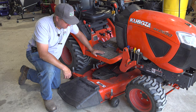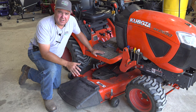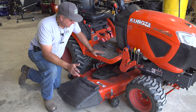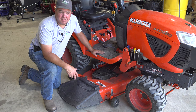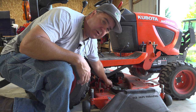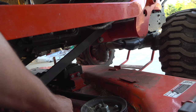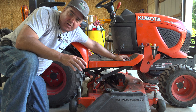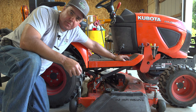The bolt hitting the mower frame got so many comments, but frankly it didn't really bother me that much — I expected some maneuvering would be required to get it out. I was just going through the removal and what I was encountering. Let's take this shield off — I haven't had this side off yet. The part I failed to mention was this double V belt. It's a double-width belt with two Vs in it. This double V belt should be stronger than a single belt like on the Deere mower.